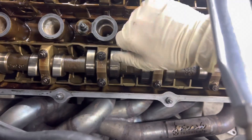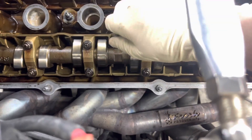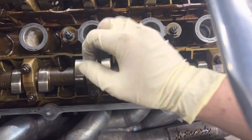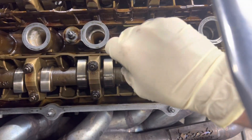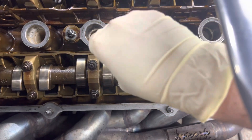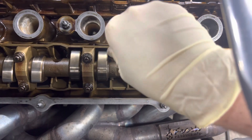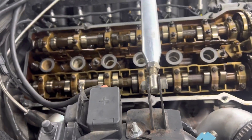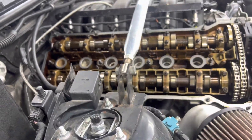Right there is where it stops — I just thread it in by hand. I need to make sure it's tight enough that my contraption actually backs off the top, which I think it just did. There's the stud installed. Next thing is to grab the nut, grab the washer, lube it up with a little bit of new oil, and start torquing.